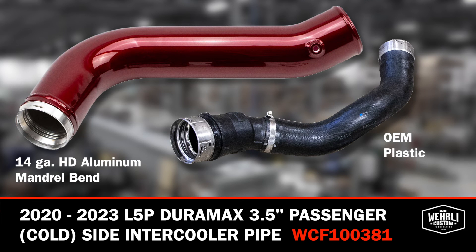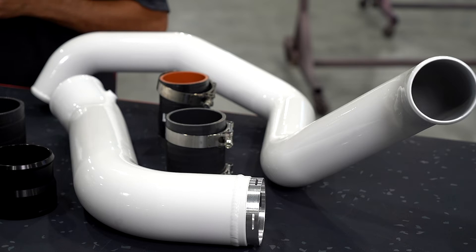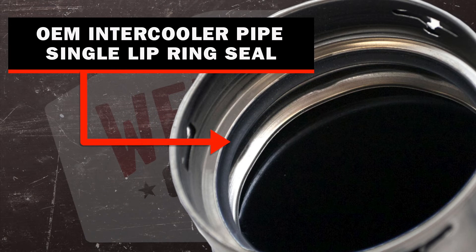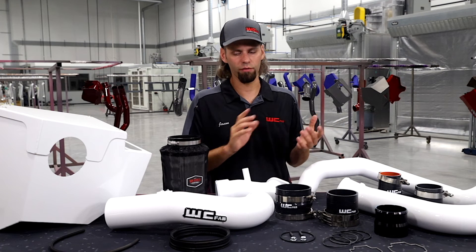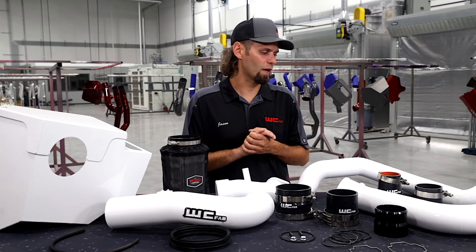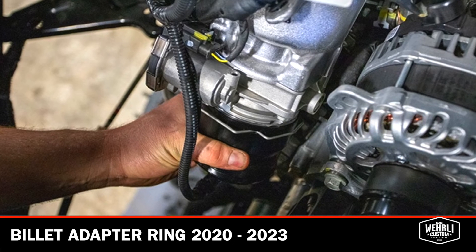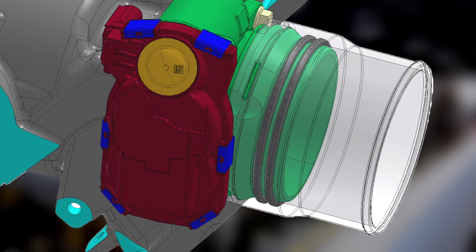This unit is a one-piece style design using our 3-inch silicone boot connection down at the intercooler. We use a CNC machined slip ring design flange at the intercooler connection, which incorporates two O-rings for sealing versus the OEM design which is just a single lip ring style seal. We include new wire retaining clips for assembly so you're not reusing any factory components. Apply a healthy amount of grease on the O-rings with the pre-installed wire clip, and that pipe slides onto the OEM intercooler connection. The 2020 to current uses a billet adapter ring that slides onto the OEM Y-bridge using a double O-ring seal and a wire retaining clip, allowing us to connect the Y-bridge to our 3.5-inch pipe with our 3.5-inch silicone boot.